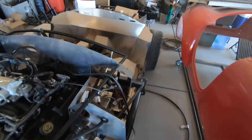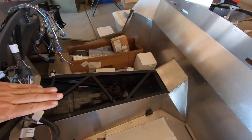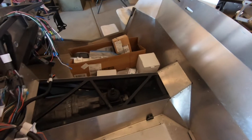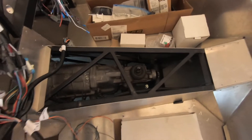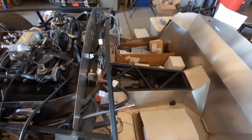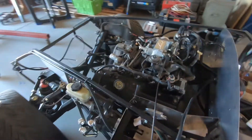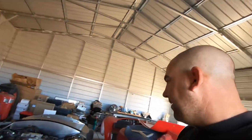Then I lifted it up, tilted it with the sling, and slowly kept pushing it back while leveling it and lowering it down. There's a bar that runs across — the shifter has to clear that — and then you just slowly keep moving it back until it sits in the right spot. I was a little concerned at first thinking the transmission mount would hit the frame mount, but that's what the A-frame is for.